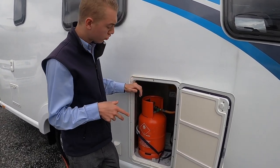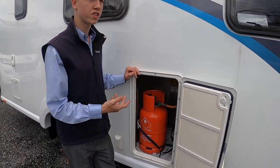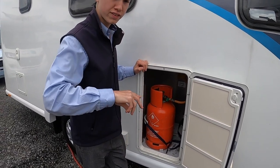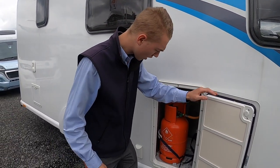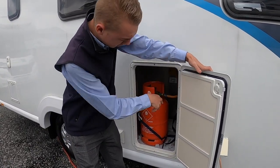When you turn it on at the top of the bottle, press the green button for three seconds — it allows the gas out of the bottle through the crash valve and into the van. It's best to turn it on just one full turn. Should you have an emergency and need to isolate your gas, it's just one turn off. You can fit two bottles — one and a spare.